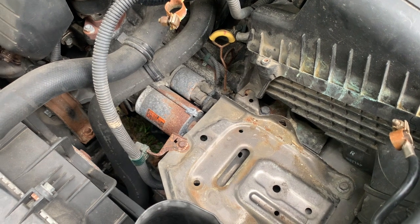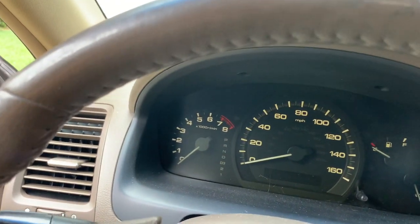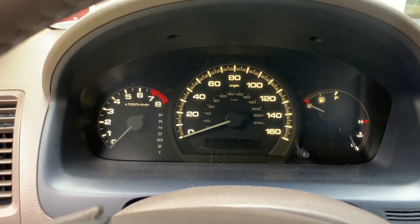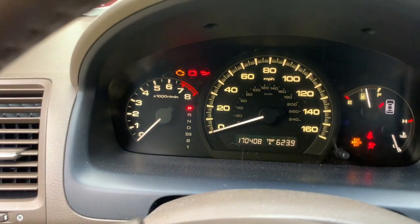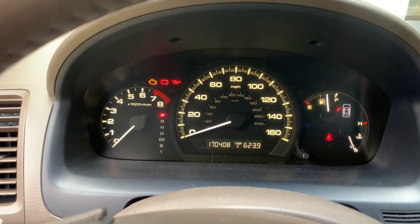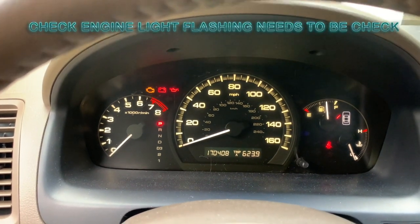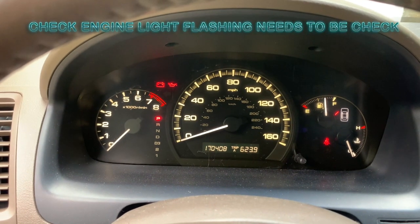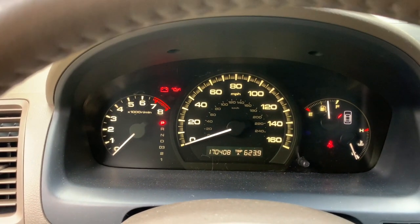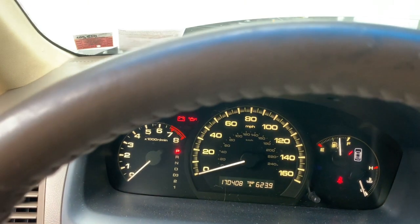Let's take that weak battery out of the picture and try the new battery. One thing you guys need to keep in mind — when you insert the key, take a look at that little green key light on the cluster. It goes off, which means the anti-theft is out of the picture. If that light remains on or is flashing with the switch on, your key needs to be programmed or you've got a bad ignition switch. But let's try it with the new battery.